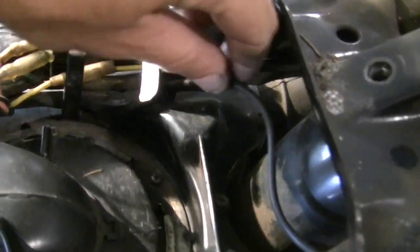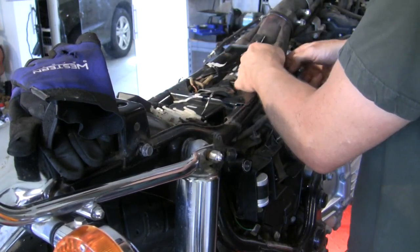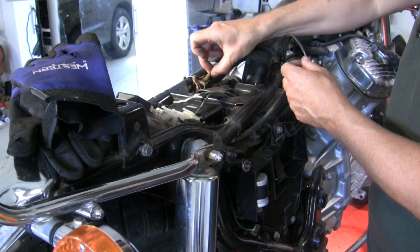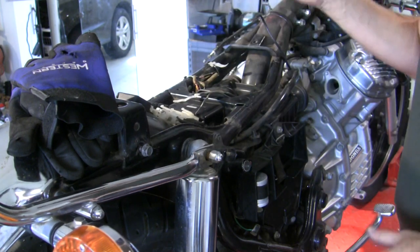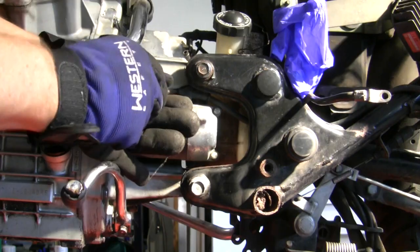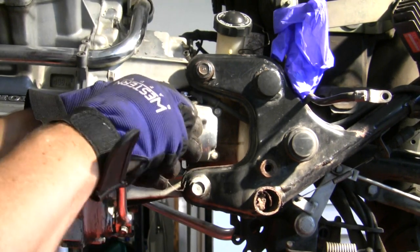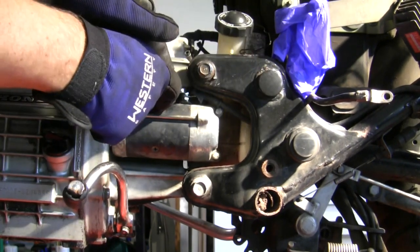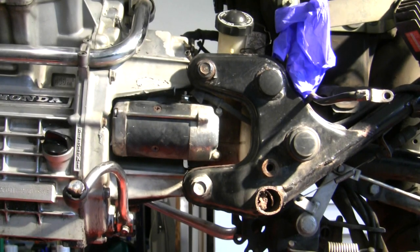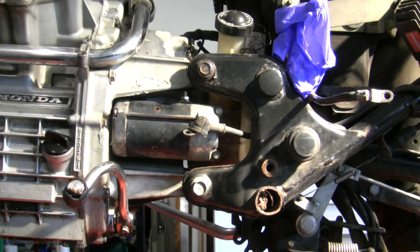With those three disconnected, there is one other wire that comes out of this harness. I'm going to note that that is a green and red — never mind, I see the green and red continues there so I don't need a reminder. All right, completely free there. You want to disconnect the starter cable — just a 10-millimeter nut, it's a tight space. You can lose your nut on the inside and get it later, then take the cable off.